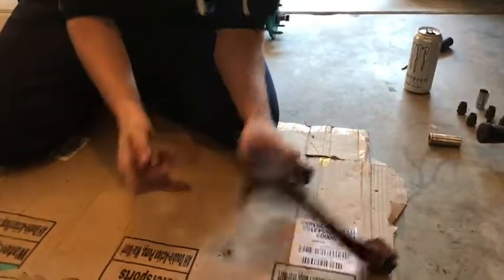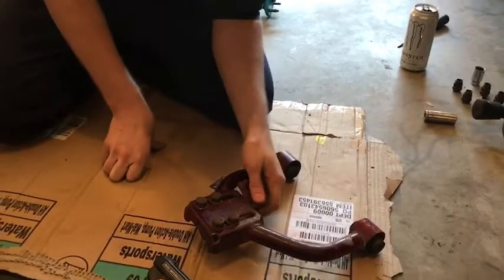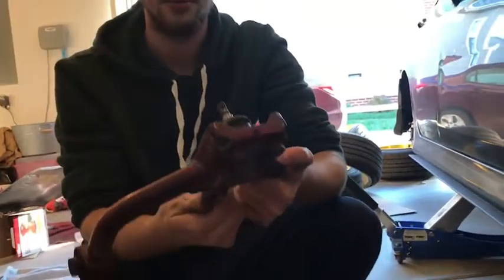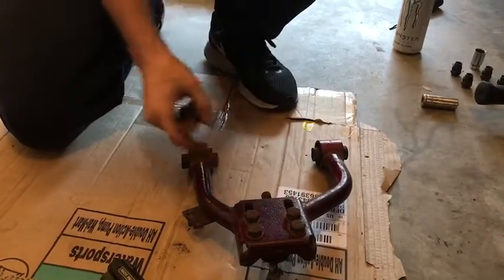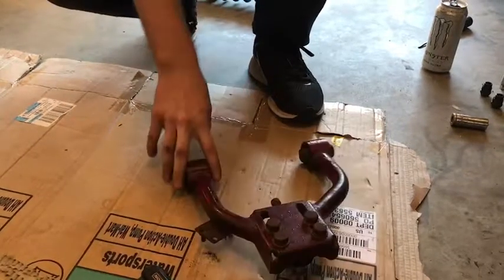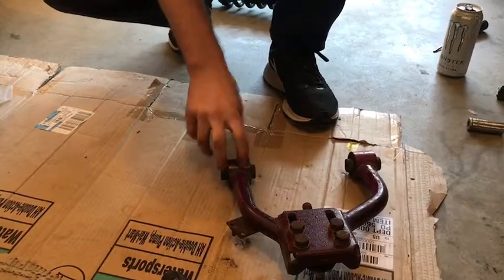So I contacted them, and I'm trying to just get this ball joint piece so I can at least have camber adjustment, but it's all the way out anyway. The max this ran was like 5 degrees or something like that. Nothing crazy. You literally loosen these 4 bolts, and then just, if you're gonna go aftermarket control arms and get anything from any company, just don't go Godspeed.